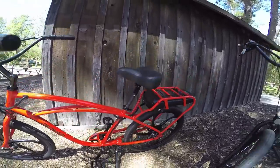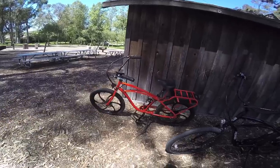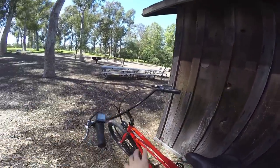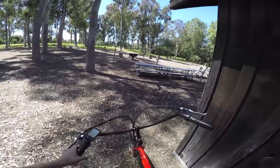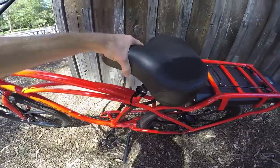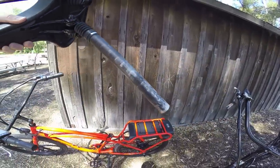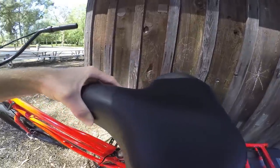These bikes aren't super soft — no full suspension — but the larger tires, the saddle, the seat post suspension, and the larger bars reduce vibration and give you an upright riding position. You don't have to lean forward; you can spot traffic or enjoy the park. Some people do want to replace the seat post — there are Thudbuster options — this one is 28.6mm diameter, about 350mm in length.